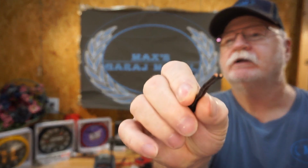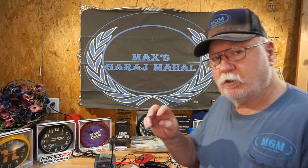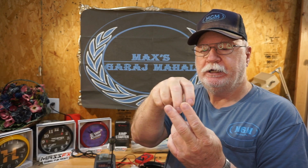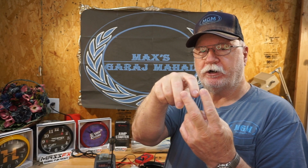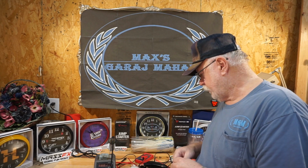And here's what the wires look like, little tiny wires. These look like they're 18 gauge. On the inside, the switch also had two little metal prongs that run down inside the switch. As the switch moved back and forth, it would either make contact or turn it off. So those were slightly loose, although that was not the problem.